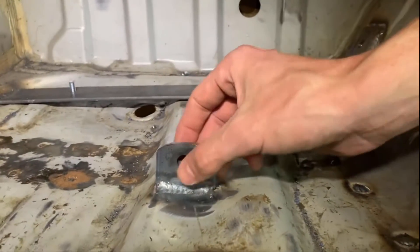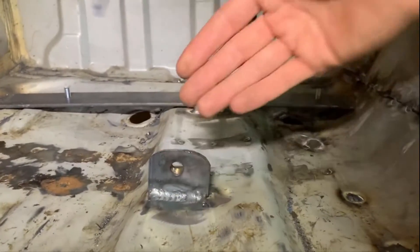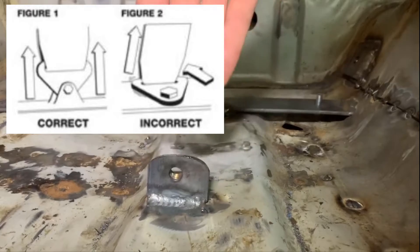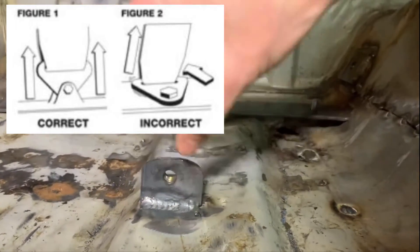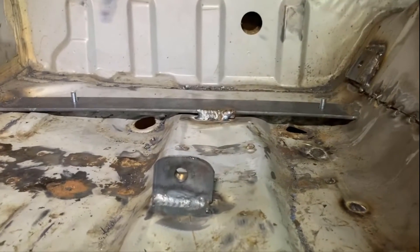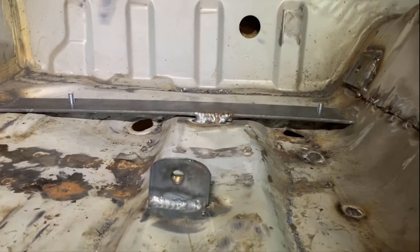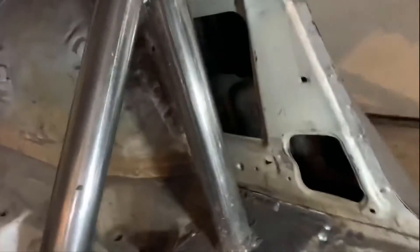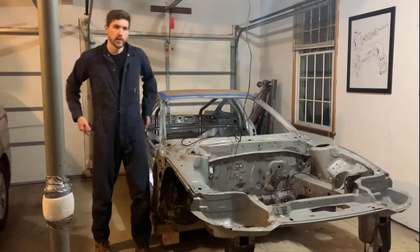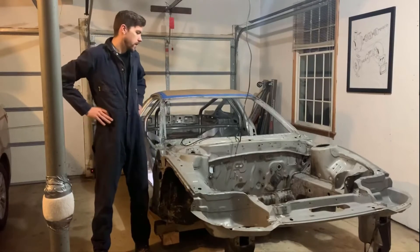The reason I had to stand the submarine belt plate up on end rather than lay it flat is because the Corbeau harness needs a flat connection in the same orientation that the belt comes up. They do make angled belt connections, but not for this setup. Since the last video, the cage is completely done - still need to clean everything up, got a lot of weld splatter, but all the plates are welded in and the entire cage is in.